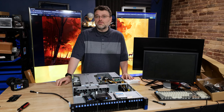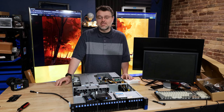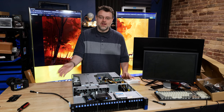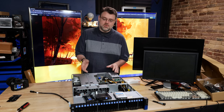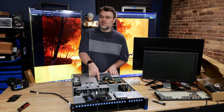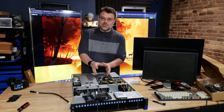And not just the buttons, there's also the configuration jumpers there in case you need them. Sometimes you do actually have to disable onboard VGA because of something that you're doing, especially with like the composable fabric scenario, because of the ROM bar region that your onboard VGA can reserve, can create some problems for something you're trying to run off chassis. And sometimes you need to disable the onboard NIC to free resources. You know, those unusual things, but all those jumpers are accessible here. You can even get to the socketed BMC controller ROMs if you really need to. And again, I didn't have to take the system apart. I can just get to it here.